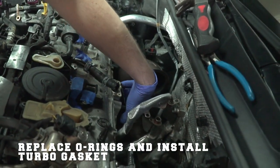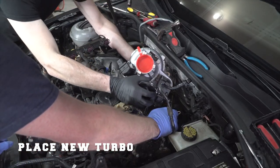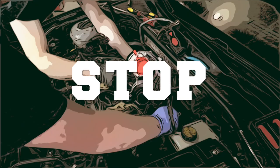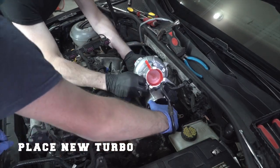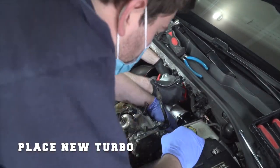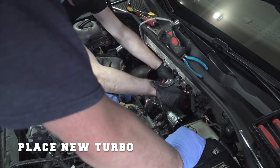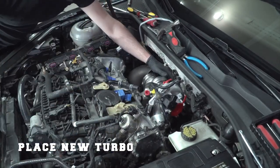Don't forget to replace your turbo gasket with a brand new one. Let's get this big spinny boy in place. Before you go any further and before you install your turbo — because on the IS38 the diverter valve connector is facing 90 degrees the other way than it was on the IS12 — plug in your diverter valve connector now. Here's where it really helps to have a friend, just to keep those connections out of the way and make sure they don't get tangled up. I installed it by positioning the flange that connects to the block straight down and then rotating clockwise towards the mounting point.